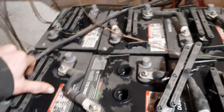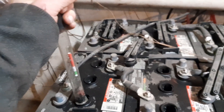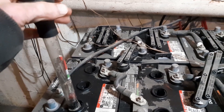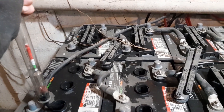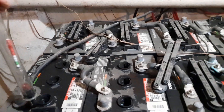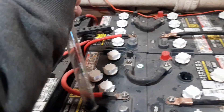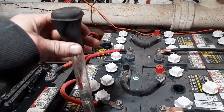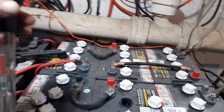Let's test another one on the six-volts. These guys might actually be starting to show their age. They still do hold onto power pretty good, but obviously it could be a whole lot better. On the hydrometer these six-volts are showing pretty shot. Let's test another cell out of the eight-volts and see what happens. Yeah - that's still way better.